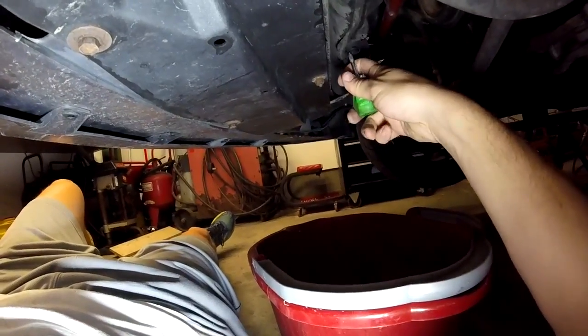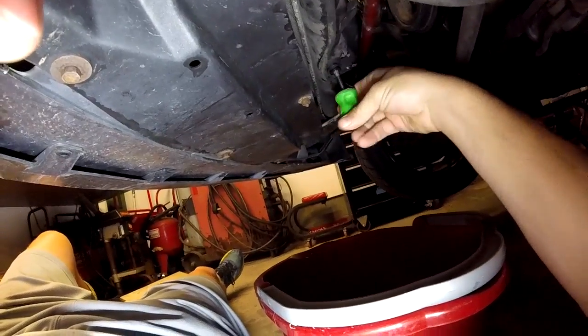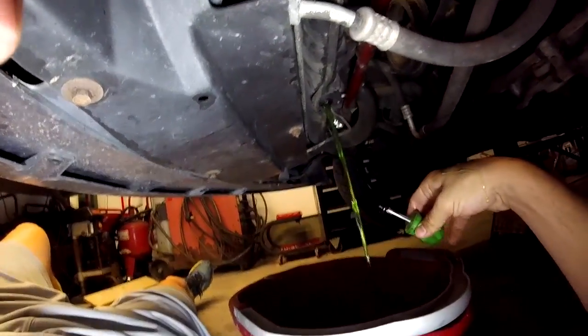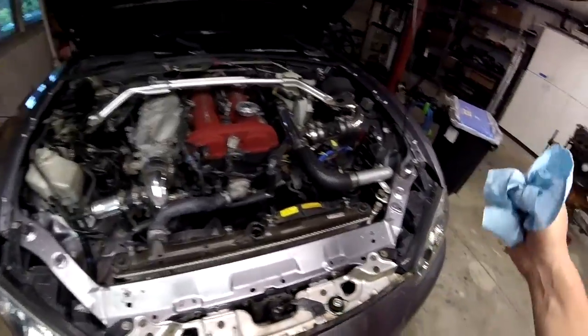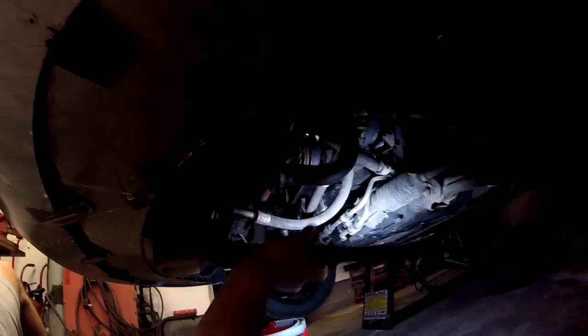This is probably going to be the most complicated part of this job. I'm just going to bring my bucket into position — this is the drain plug. Pop it out and everything will start leaking out gently at first, and then I'll go up top and take the cap off. Then take the upper hose off. The lower hose is down here, but we're going to let everything drain first before we take this off, because there's always a little extra coolant in there.